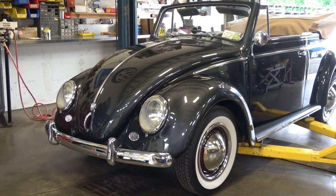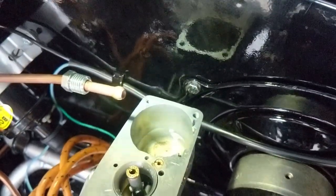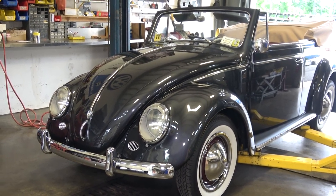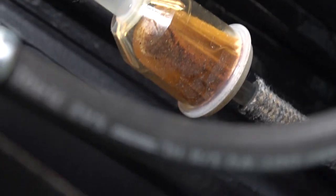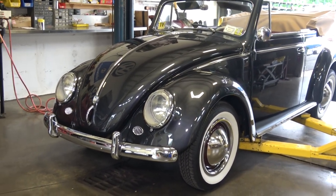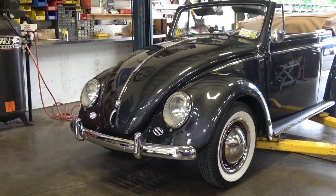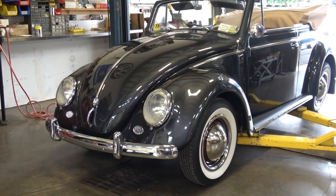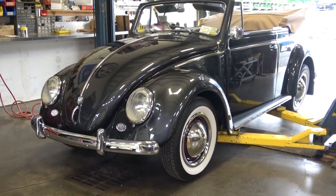I took the top of the carburetor off and looked down — the bowl was empty, so there's some fluctuation in the fuel being sent to the carburetor. The fuel filter mounted underneath the back seat had some sediment in it. Even though I have a brand new gas tank, fuel filters, a brand new rebuilt fuel pump, and a brand new rebuilt carb, I think the sediment in that 68-year-old fuel line through the chassis is starting to break loose — ethanol will free up the junk in your old fuel line and start passing it through.